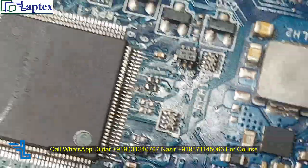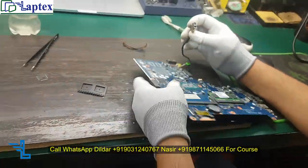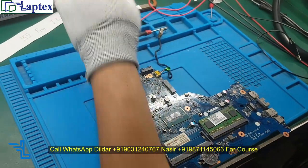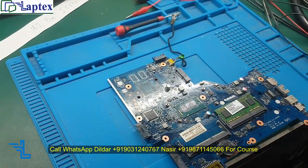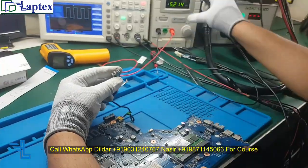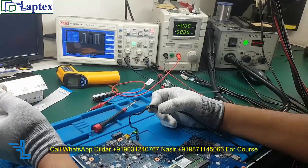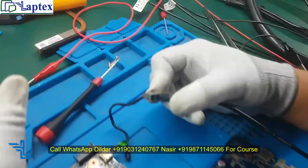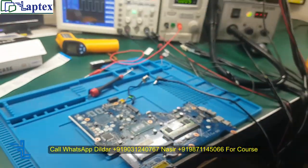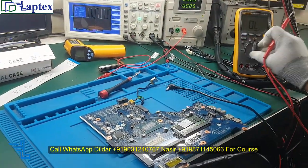Now let me check, because the DC light was not appearing on the DC jack, which is a clear indication of LDO presence on the motherboard. Let me inject it — at least I should get the DC jack light, which is the DC input indication as well as the LDO indication. Still the condition is the same — the light is not available.